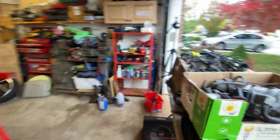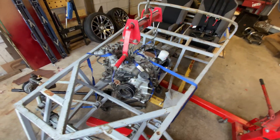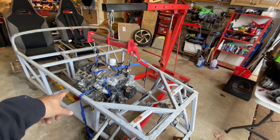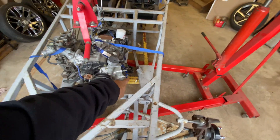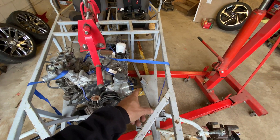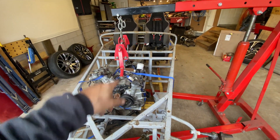Hoist is in position. I went ahead and removed all the ancillaries and the vac pipes and the wiring loom and all the connectors, because they would just snap as soon as you put a hoist strap near them. So we're ready to lift it out. I'm going to take it out and drop it over there, see what's going on underneath, see if I can get these mounts off, and then probably cut off that supposed engine mount down there. But at the moment it's just going to get in the way. And I'll get the gearbox out and take off its mounts as well because they're not going to work.